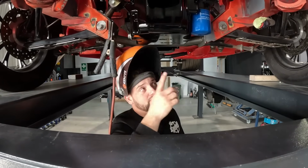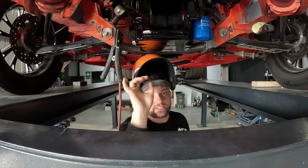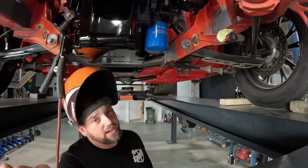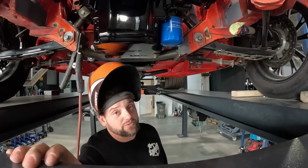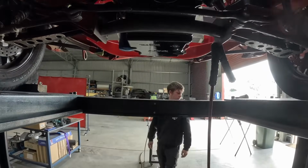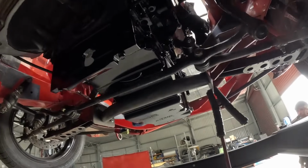So we've got the connector in it. We've changed the plans. It's gonna stay bolted up in the factory plates to the sides. So we're where it was originally anyways, where the plates have been put on. They're nice and easy to get to. We thought it was going to be a bit of an issue, but it's definitely not. So I'll grab this, pull it in here. They're tacked in place there. Sitting nice and flush this way. So level, perfect. So we're going to get that in. We'll weld predominantly all of it up as much as we can, let it cool down in position, and then we'll take it off and do that last little quarter left of it. But we'll smash that out now and get it done.